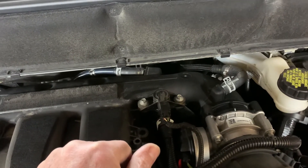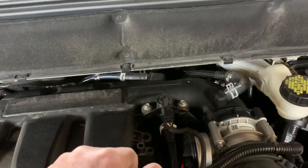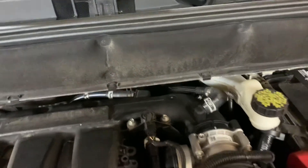If there is vacuum, the valve is bad — it's stuck open. If it's closed then you probably got something else going on. So anyway, that's where it's at on the 2016 Lincoln MKX.